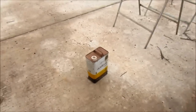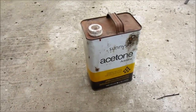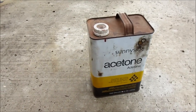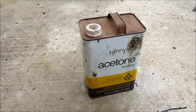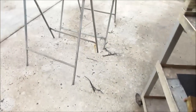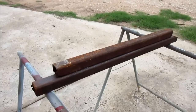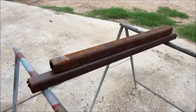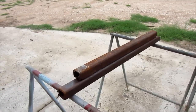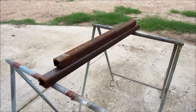The other thing I failed to mention earlier: use acetone to clean the bottom of the dash cap before you install it. You can use anything similar — denatured alcohol, acetone, paint thinner — just be careful not to get it on other parts of the car as it can ruin materials and fabrics. You'll also need some type of weight on top — I use old square tubing, inch and a half by inch and a half. Put the cotton rags down, then put the weight on top. Try to keep it as even as possible — books, dictionaries, whatever you have. Pay attention to areas where the dash may be a little higher than others and make sure you get those down.